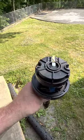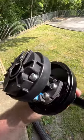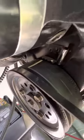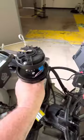There it is — locked-out magnetic distributor, as previously viewed in a video. We're going to install it on the run stand here. We got the timing roughly 15 degrees before top dead center. We're going to stab this thing in here and line it up with number one the best we can.